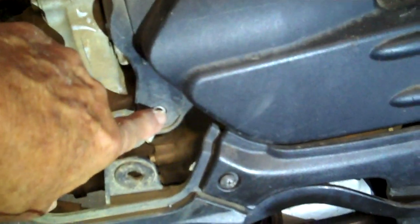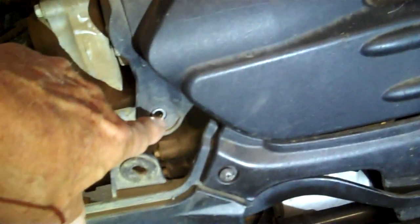There is this piece right here. There's one nut down at the bottom left — you need to take that loose. When you take that out, you can pull this back and get to those two nuts that are holding the starter in place. That's it. It's real simple.